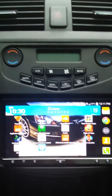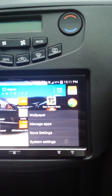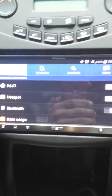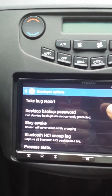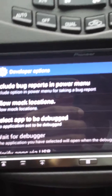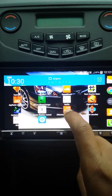The first thing you want to do is go into developer options. It's probably easier from the phone — just hit menu, go to System Settings. I'm using Nova Launcher so it looks a little different. Go to More, scroll to the bottom. Once you root your phone you'll understand what this means. Click Developer Options, scroll down to where you see 'Allow Mock Locations' — this is important for GPS. Click the checkbox for that.